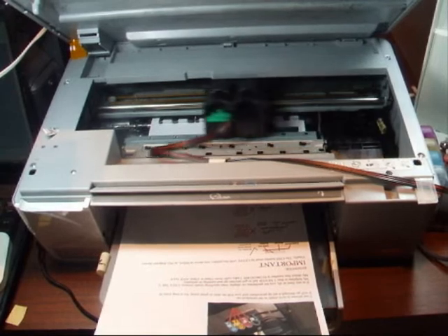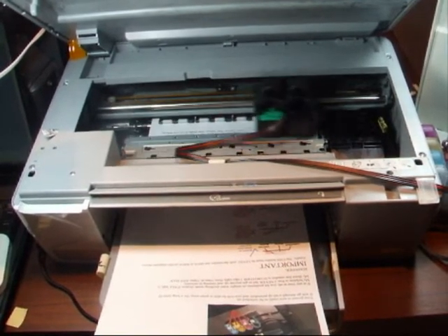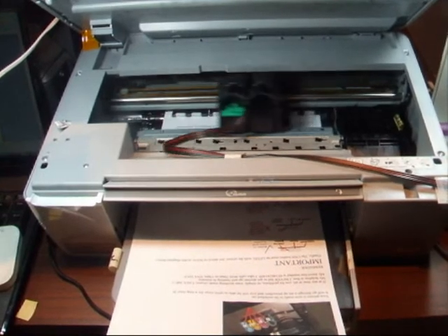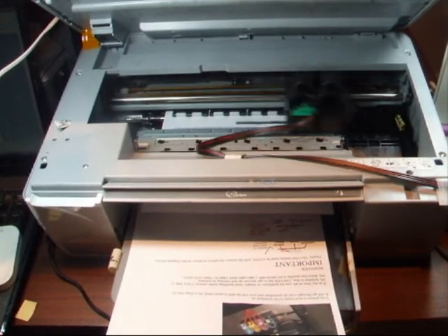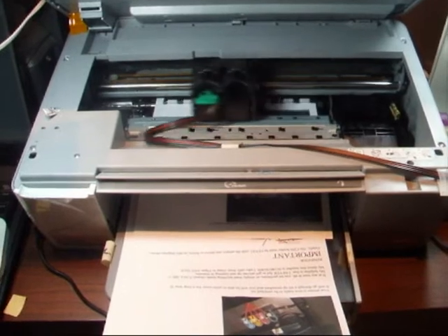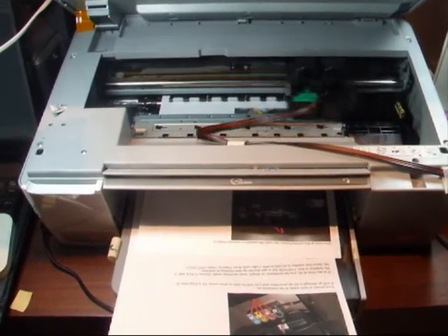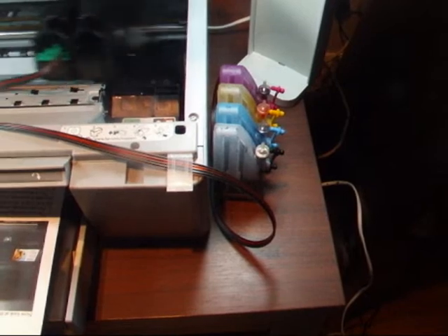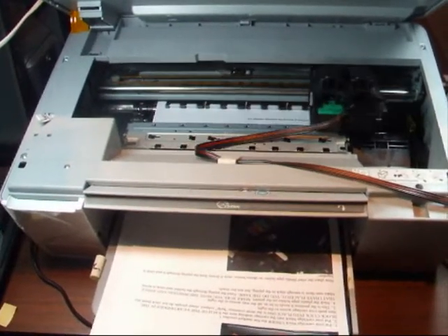The 350 and 351 go onto other printers as well. If you can't find the videos from me, just get in touch and we can work out how yours goes — it's all to do with the routing of the piping. But as you can see, it's printing perfectly. No more heavy costs if you've got this printer. I'm going to do more 350 and 351 videos, but this one was needed urgently. So don't forget — let's go through it again: your two clips go into place, you put your bottle next to your printer on the same level and put your four air bungs in, you click your cartridges in, you put your piping into the clips, and then you print away. It's so simple. Any questions, just get in touch with me. Thanks for watching.